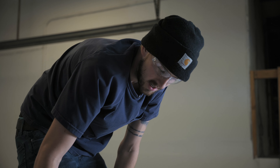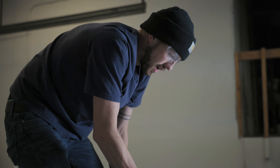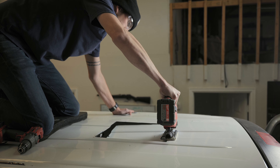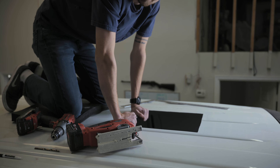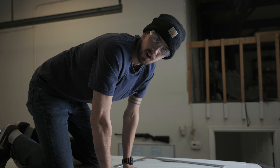When you do this last cut, if you have a floor or other interior in there, you'll want to hold the piece up so it doesn't fall in. Right now we don't mind if it falls because there's nothing inside. And there we go — just like that, we have a hole cut in the van. This is a scary part to look at. There's no going back from here.